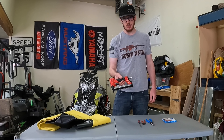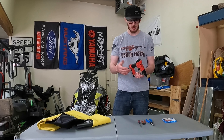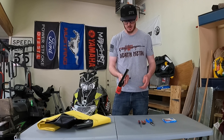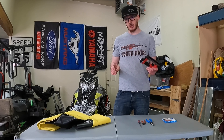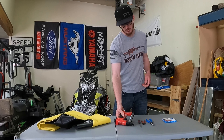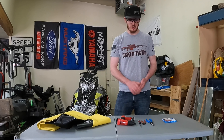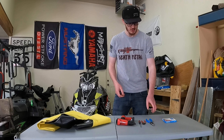I've got a pneumatic stapler — it takes 3/8" staples. You can use more or less depending on what you want, but 3/8" is just a pretty good size. It's going to help that fabric stick right to there. They do make electric ones too, but you can get into this pneumatic one for about $40, plus your staples. Really a pretty cheap investment and you can always end up using it for something else.